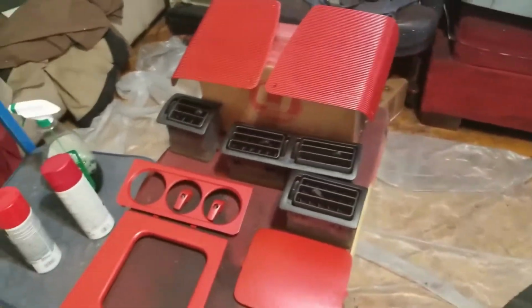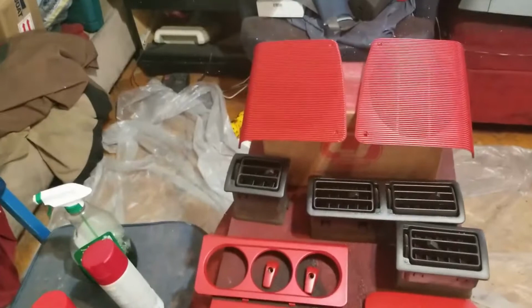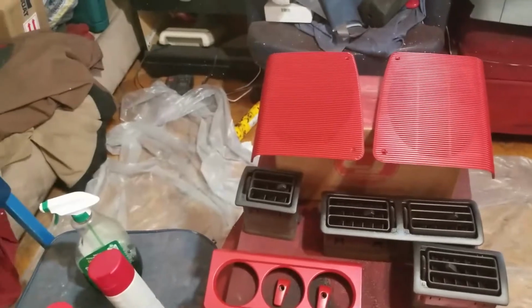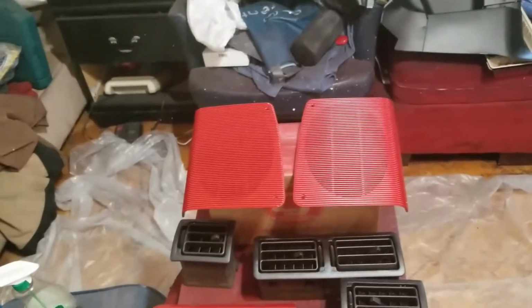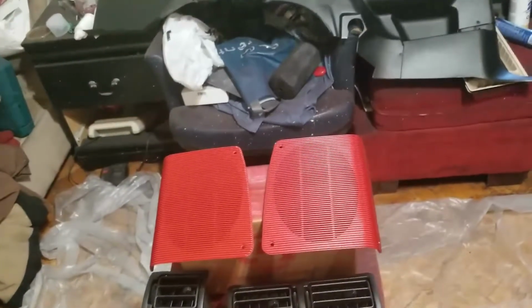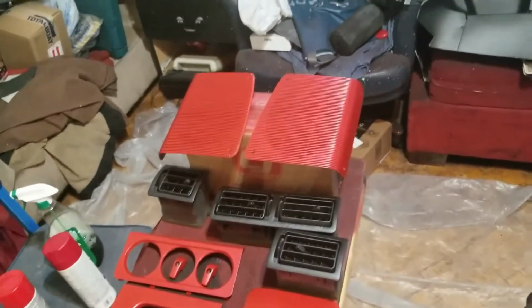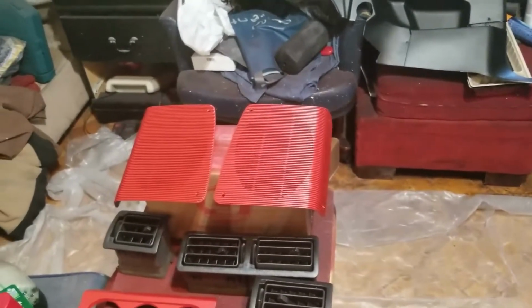Here's why. One, the wash doesn't remove all the stuff that's in your microfiber towel. Okay? I have had this problem happen to me before where I took a towel right out of the dryer and started wiping it down clean, and then I started spraying my paint, and next thing you know, boom, fish eye. And I'm like, how in the hell did I get that? Well, the reason I got that is because the microfiber towel still had residue inside the fibers. So use a brand spanking new microfiber towel when you're cleaning it down with the alcohol. Do not use a pre-used microfiber towel.